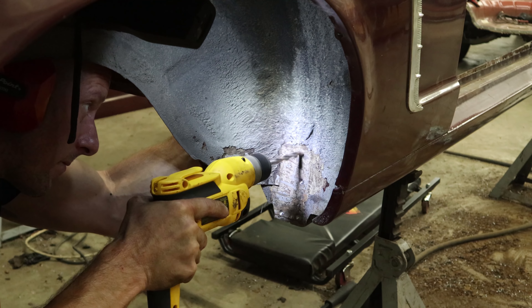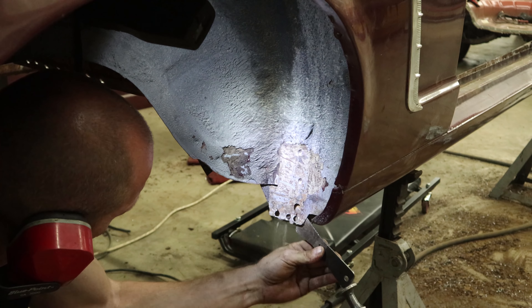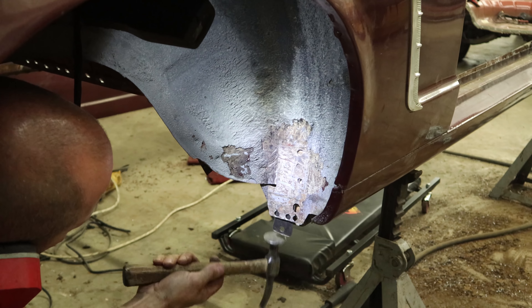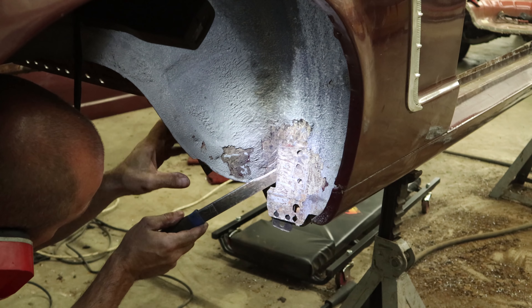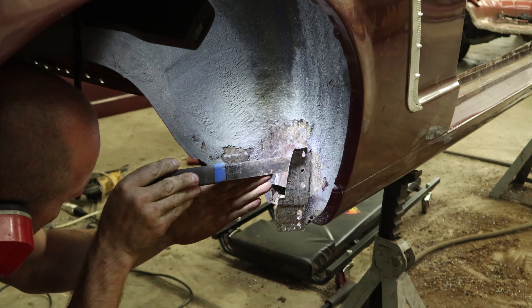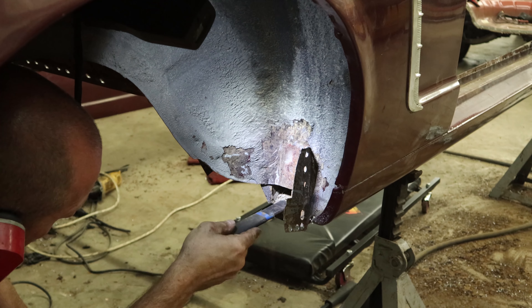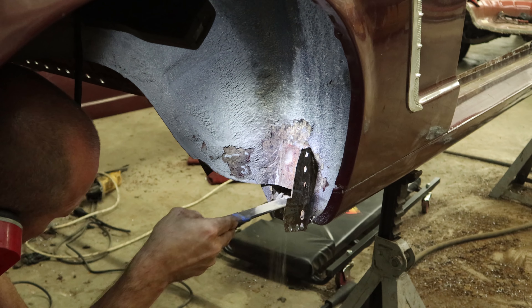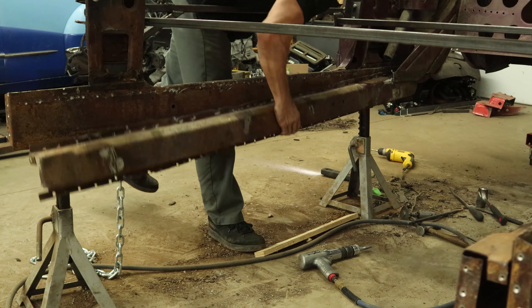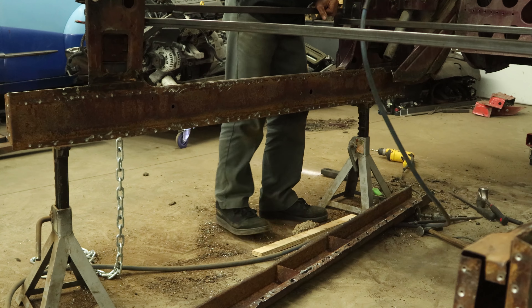Now into the wheel well — we'll take the part off that's welded to the frame rail, just a few spot welds, drill them out, break them loose. I'll pry that little piece back, make a little door, so we can get to the couple welds underneath that. And presents — that's what's left of the frame rail. Now we can wiggle it out of there. I win.